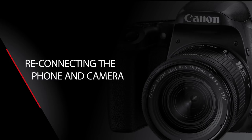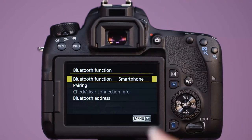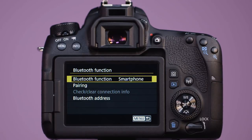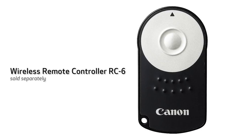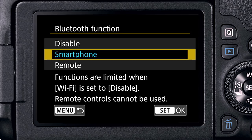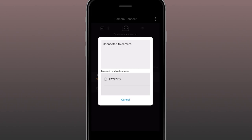When you turn off the phone or camera, both Bluetooth and Wi-Fi will need to reconnect the next time you turn the camera and phone back on. The camera normally remembers previous devices and makes it fairly simple to reconnect. We suggest leaving Bluetooth turned on in your camera's menu even if you're not using wireless features — this will make reconnecting later easier. If you want to use a traditional infrared wireless remote controller like Canon's optional RC-6, you will need to turn Bluetooth off in the camera menu. When you turn it back on, it will normally reconnect automatically with the smartphone as long as you haven't told the phone's Bluetooth settings to forget this device.